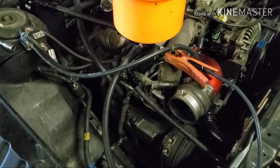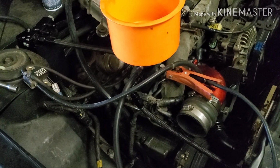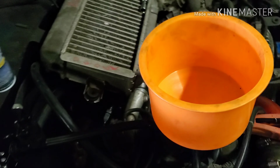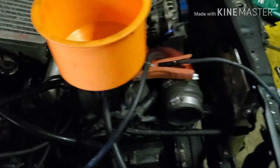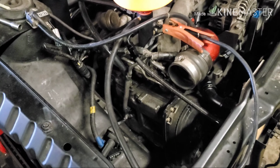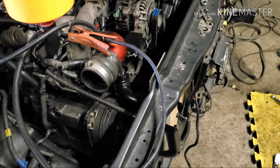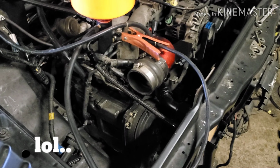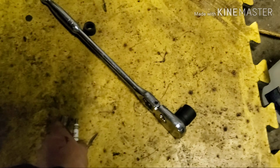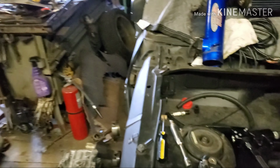It wouldn't run for more than like 5 seconds. We kept trying different things, and then we kind of figured that maybe the spark plugs were no good, because Bert was saying that it's kind of a sign that it'll clear up once it warms up. I don't have an explanation, but Bert said that's how it is. If you have a bad plug, it'll run rough at startup, but get better as it warms up.